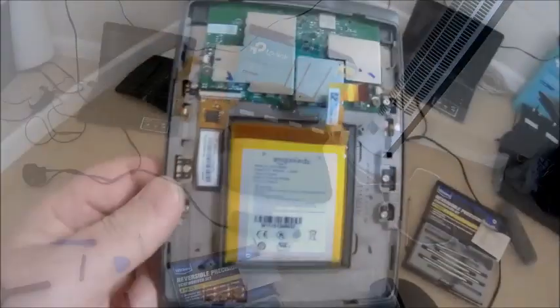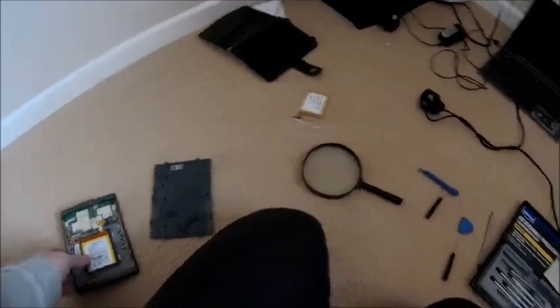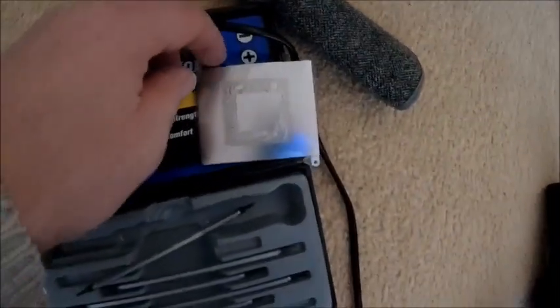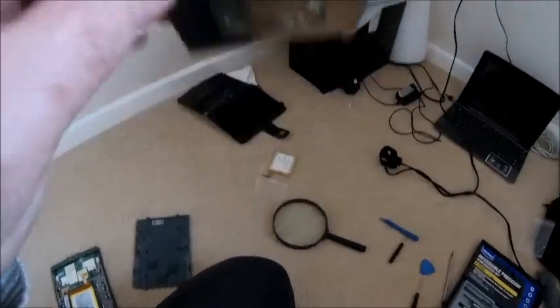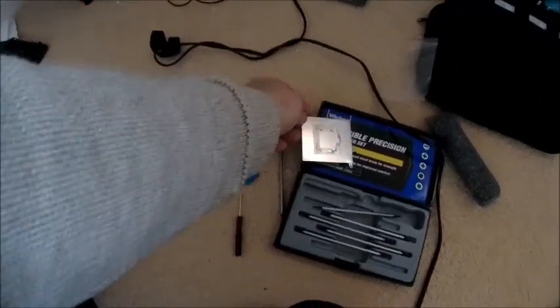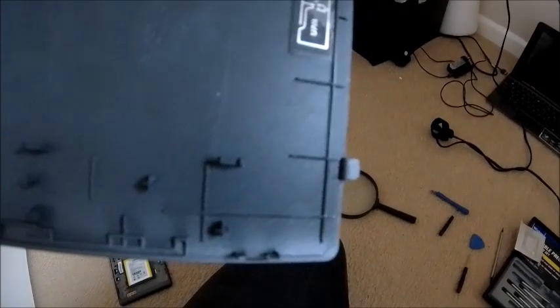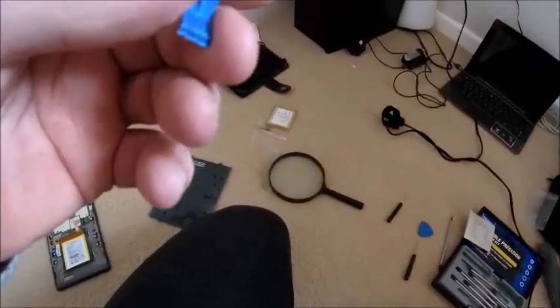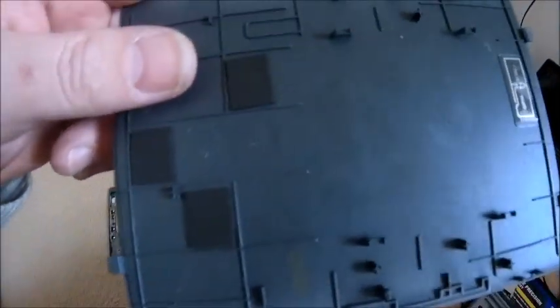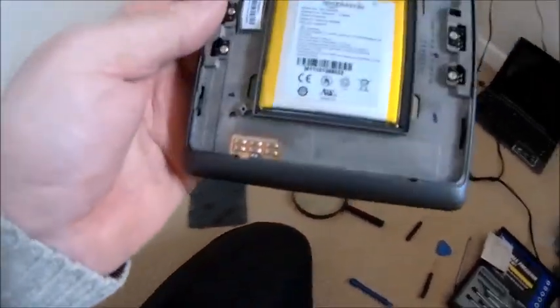The back's off. Basically I just took a hairdryer and heated up the middle bit there, because the battery tray is here — that's taken off now. Sorry to show you all this but it's very difficult with one hand. It is stuck to the back end, so you literally have to work around the corners and use the tools that come with the battery to get underneath it and prise it off. It's not a particularly difficult job but it's just time-consuming. It does sound like it's breaking when it comes off, but it just pops off quite nicely as you can see.